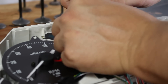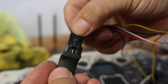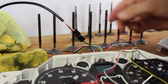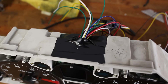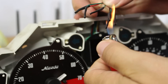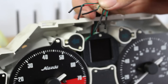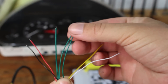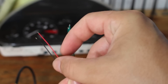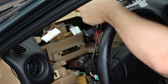Run all of the harness through the top of the cluster and drop the CAN Checked in — the three factory screws will hold it in place. The harness has plugs for the larger items so you don't need to drill too large a hole; run the harness through and plug everything back in. Put some electrical tape over the hole to prevent dust from getting inside. There are additional wires for up to four extra sensors; cap those off with heat shrink wrap for future use. The CAN Checked also has a 5-volt output and ground for those additional sensors.